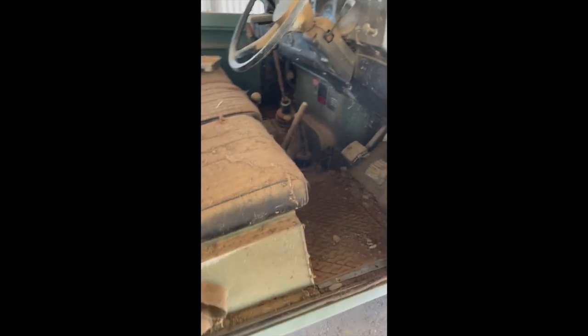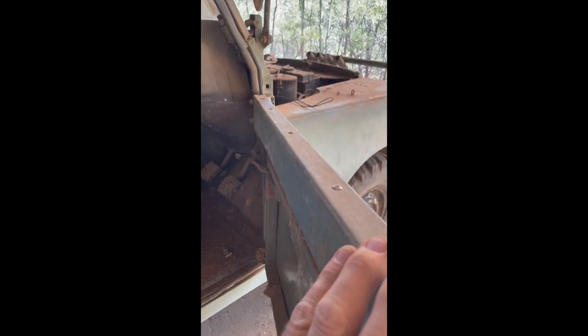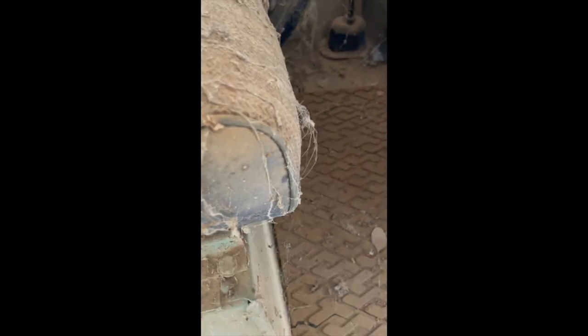This has only been here a couple of days and we've already got the statutory oil leak, but that's just because I've disturbed it. Undoubtedly pretty much most of the seals — gearbox, diffs, transfer box — they'll all have hardened off and be leaking like there's no tomorrow. Moving on to the front — the doors look pretty good, just the half doors at the moment, but that wouldn't be difficult to get the tops for them. They look pretty good; the bottom frames are rotten though unfortunately. That's gone right the way through there — you can see my finger. More mud wasps again.